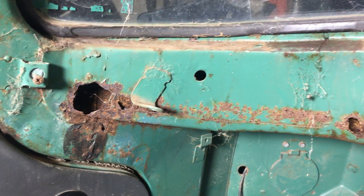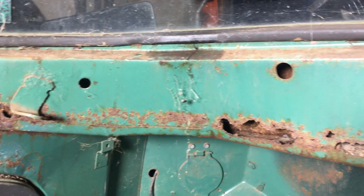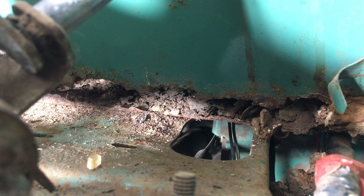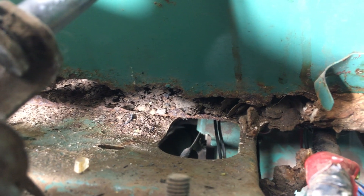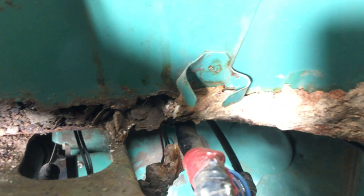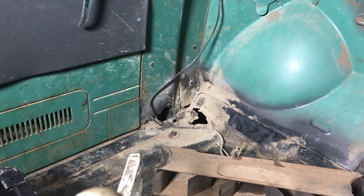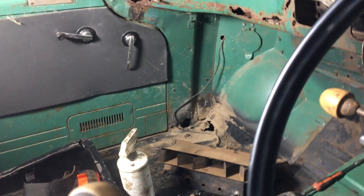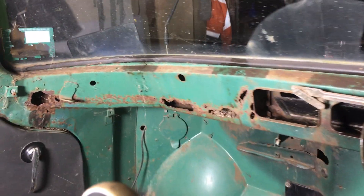I've got the dash out but it doesn't look real good. This is the Achilles heel of the Stout — in the back of the firewall here, water gets into it. That rust is pretty horrible. There's a whole lot of bog in there disguising more. Down there in the bottom of the floor, all mud comes up through that hole — we probably should weld something over that. Five years ago when I had it in the workshop, the accelerator basically fell out of the floor. This is a big thick plate I made up because the bottom of the floor was half missing. It's definitely the body in these things that goes — the rest of it's pretty tough.